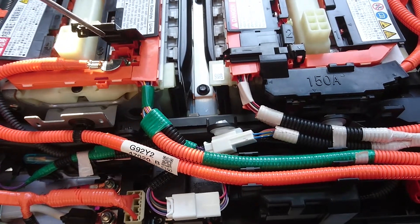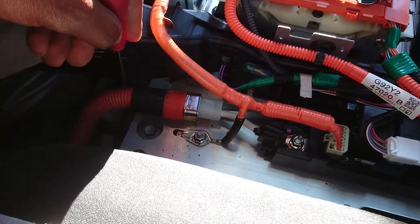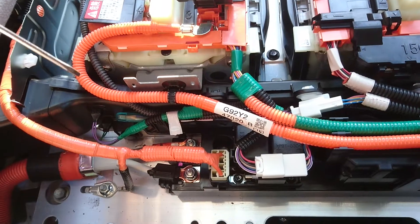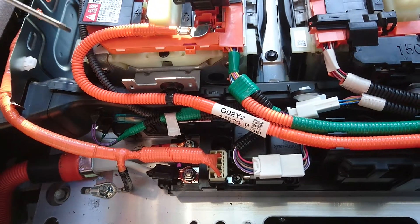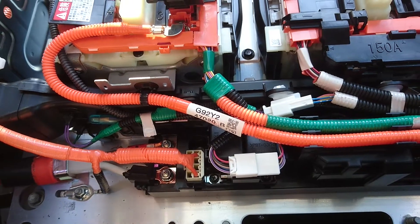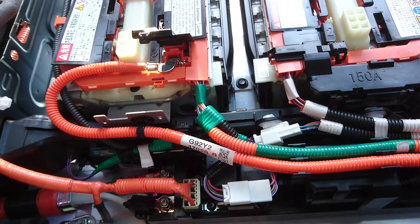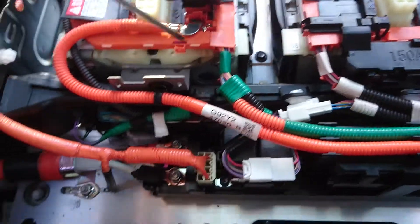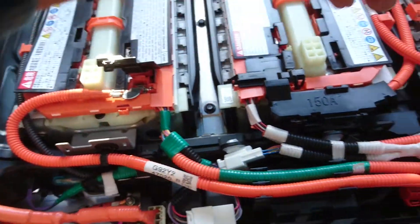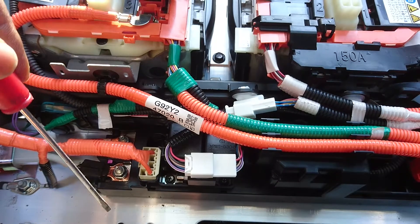I've seen some people connect through here — they cut the cable and make a junction — and then they forgot to switch off the pack and the whole thing broke. So if you're going to do this on any hybrid or electric car like a Nissan Leaf, remove the cover, remove the battery from the car, drop it on the ground, remove the cover on top, and connect behind the contactors and relays. This side is behind, this is in front. Connect behind the relays and contactors and your car will be safe.